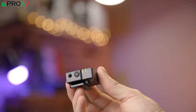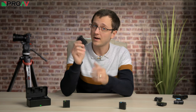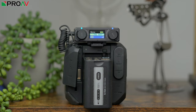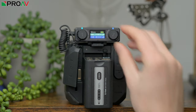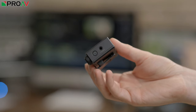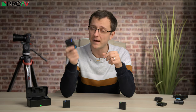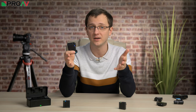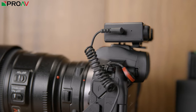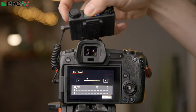There's a built-in microphone on the top or a 3.5mm jack to connect a lav mic with. The dual receiver looks very different. There are two large physical dials for controlling the levels of each channel of audio, which you can push in to mute each transmitter. In the centre there's a screen to show the battery life, levels, and status of each unit. There's a dedicated power button so you can keep it on your camera without draining the battery, plus a headphone socket. On the other side there's a 3.5mm line out to connect to your camera and a clip along the bottom — the same size as a cold shoe mount, making attaching it to your camera incredibly simple.